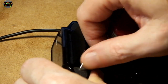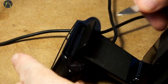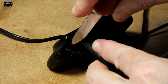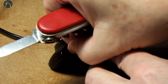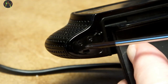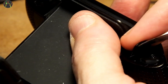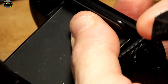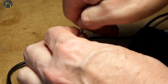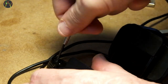The first job is to disassemble the C920, which requires removing the rubbery pads on the left and right underside to expose the screws below. At least on mine, the pads are quite firmly glued in — a good chance to stab yourself. With that pad gone, two screws are visible and have to be removed. The second pad finally removed. The screws are extremely hard to remove; Logitech really doesn't want people to get into the C920 it appears.